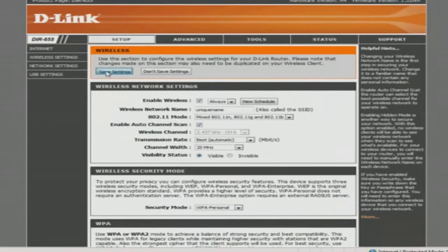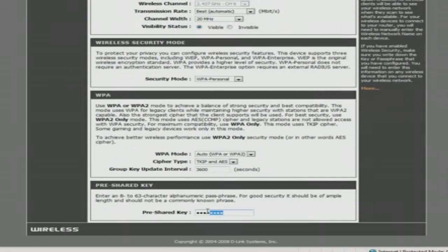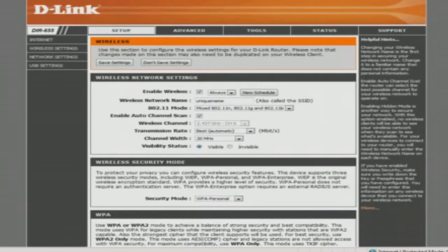When you're all done with that, hit Save Settings. The router will reboot. You'll have to connect to the network now with this unique name, which you will see because the router is broadcasting — you'll be able to see the name in your wireless network list. Click it, it'll ask you for the pre-shared key, you'll type in the pre-shared key, hit OK, and you'll connect to the network. And now you have done the very basics to secure your home or small office wireless D-Link router. For more information, go to www.wificastle.com.